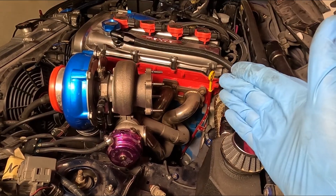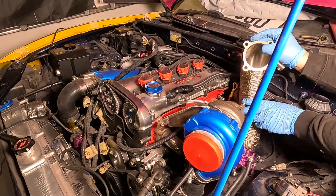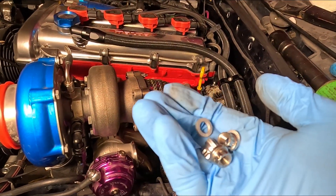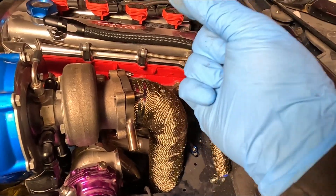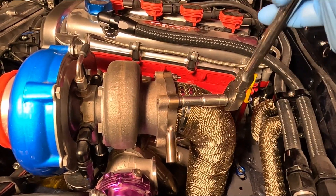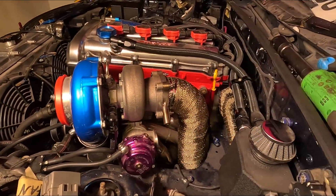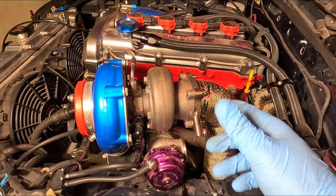Now the downpipe is finally ready to install. I haven't put the wideband sensor in just yet — that'll come later. That's just held on loosely with one nut for now. I'm going to go underneath and secure it to the gearbox with that new bracket I made, and then come back and do the other nuts. All secure down at the gearbox — it's time for the last few nuts. I'm using Nordlock washers with these, which are a really good addition if you have any doubts the nut may come undone. I'll put them on the studs first and then the bihex titanium nut, then tighten the downpipe. The joys of these bihex nuts is you can put a lot more torque into them. It's a shame to hide the nice stainless steel downpipe but this Funk Motorsports heat wrap makes it look really good and it's going to protect everything around it from the heat, so hopefully no melting paint or melting lines, and it should improve the exhaust flow. Now I really need a turbo hot side blanket to go with that — that'll really complete the look.